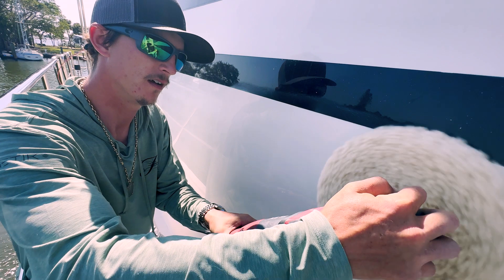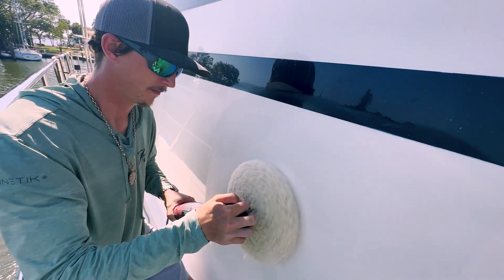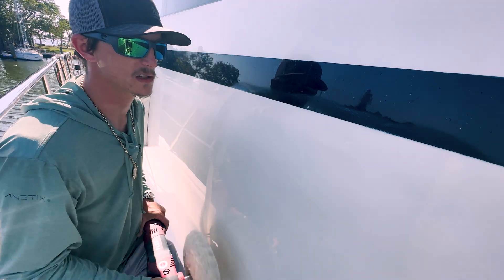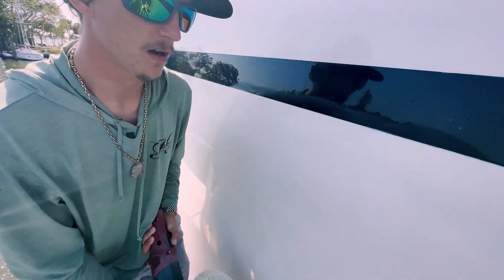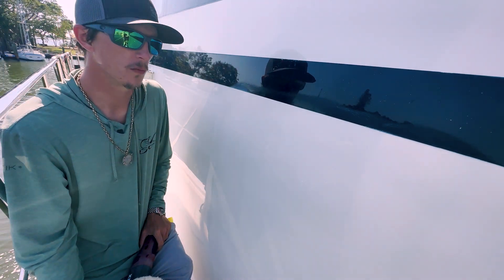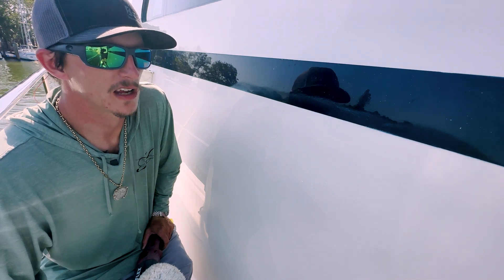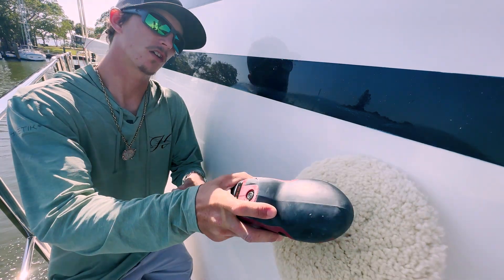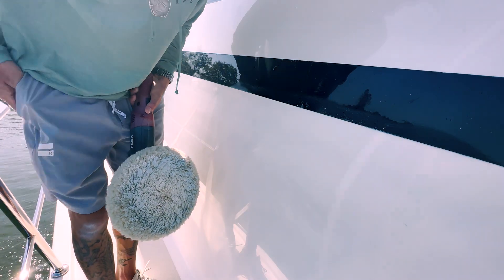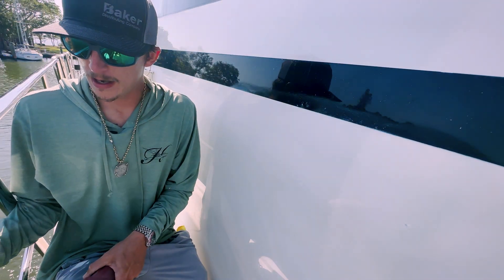I'm going to bump it up a little bit higher, still right at two. Keeping the pad pretty flat is so important, especially with paint when cutting. I've seen a lot of people talk about digging the pad at an angle, but with paint that's not something you want to do — you're going to do more harm than good. If you end up doing a first cut holding your pad sideways, your last pass needs to be flat. It really needs to be at least two more passes, keeping it flat, keeping it spinning fast, allowing it to do its job.